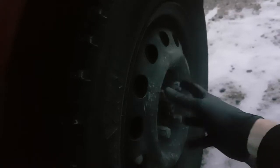So the major tools you'll need is obviously a front wheel drive bearing press kit. I think it's about $100 on Amazon Canadian. A slide hammer kit, and it goes onto the hub. You'll see it, and it pulls the hub out. And then you need some special tricks to get the big snap ring out that holds the bearing in the spindle. So you guys will get to see it as we go through.